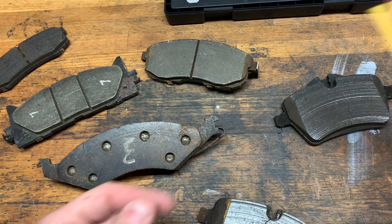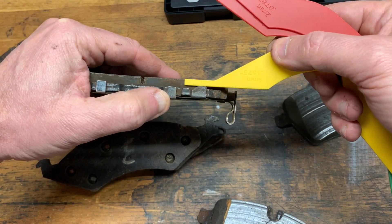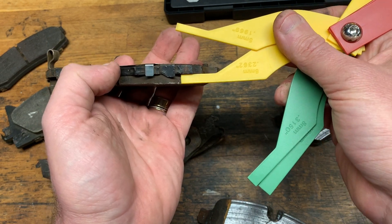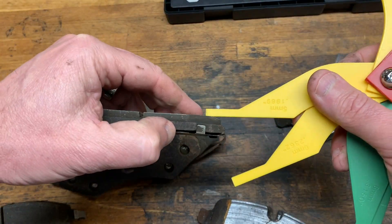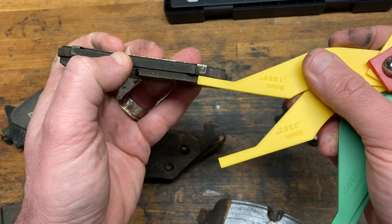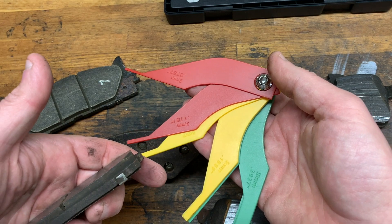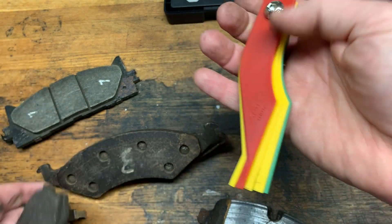The quick slip tool goes in between the brake pad friction material and the brake rotor. It does an okay job of sort of determining the thickness — it's a good go/no-go gauge to show customers. But I've seen a handful of people mess these up because it's not really an accurate way to measure brake pad thickness. You slip it in between the pad and the rotor, and it works fine for a quick inspection, but it's not certified for state inspection in Pennsylvania. A lot of people use them though, and frankly, it's better than nothing.